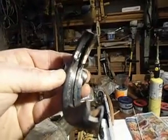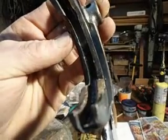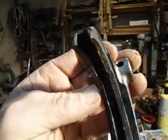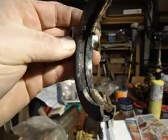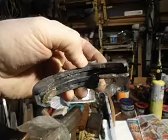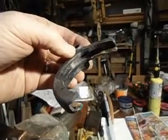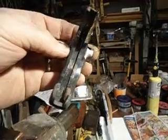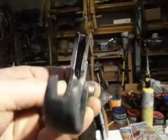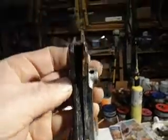I did basically the same thing. I picked out a shift fork — it wasn't too bad on the left side, hardly anywhere. Just mostly it was all on the right side. I set it in a vise like this and did the same thing to lay in the brass. And then very carefully used my little Dremel tool grinding wheel and ground it, keeping checking it with my calipers until I had it pretty close to the same gap, top and bottom.